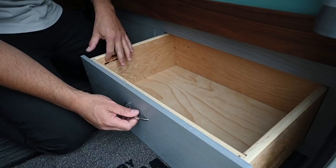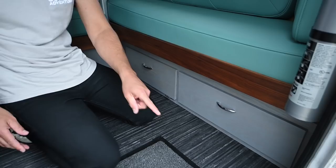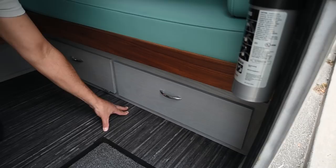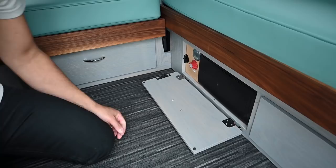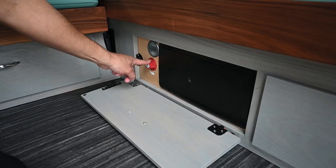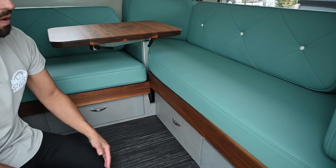I got vintage-style hardware used throughout. To hold the floor down on the edges, I use the banding that Airstream uses on their new trailers — the floor is not glued down, just tacked, and the furniture holds it throughout. This portion here used to be a drawer in the original configuration — I didn't change the furniture layout, it's all in the same spots, just redone. But this flips down now and I have the Victron Energy battery display to see my battery charge, a battery disconnect switch, and the AC/DC breakers and fuses. It's a modern fuse distribution box but hidden so you can't see it's newer.